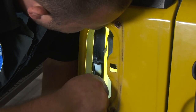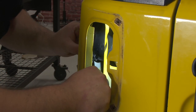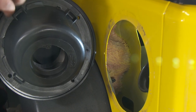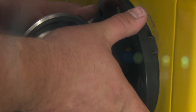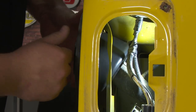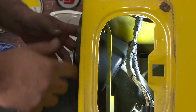The tabs are pretty hard to see, but just use a flathead screwdriver to push on them and kind of pull the fuel filler out while you push. Then grab your Drake Off-Road fuel door and line up the pin on the backside of it with the hole in the body of the Jeep. Push on it and make sure all the clips pop into place and it's seated flush with the body.